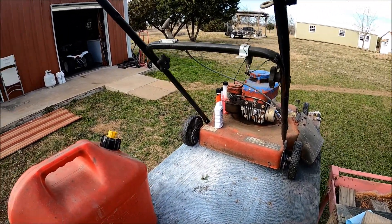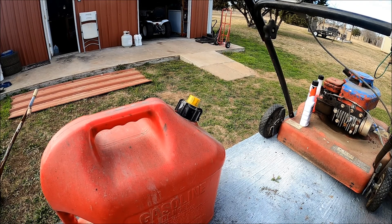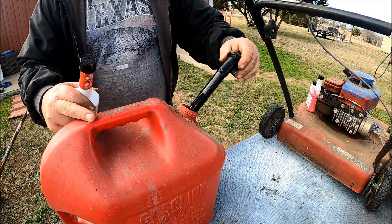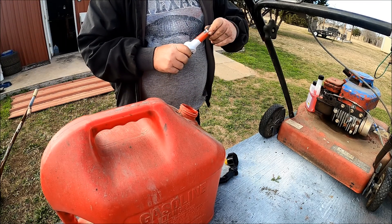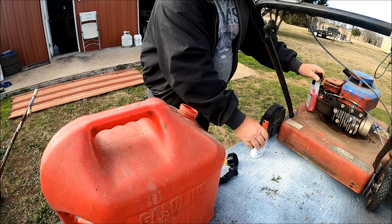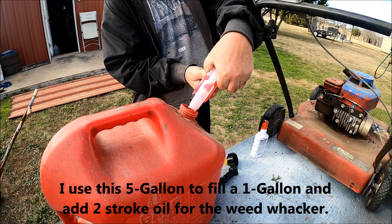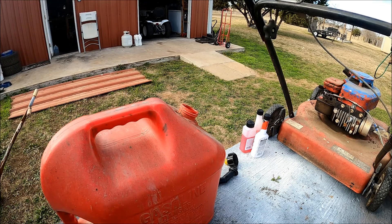Been working on the Heinz 57 — you can hear Fort Hood over there. I don't have any fuel mix, so what I do is this is five gallons exactly as measured at the pump, and we'll put one ounce of STP fuel injector cleaner in it — one ounce — and we also put one ounce of the red Sta-bil in it — one ounce. We'll shake that up a little bit and we'll put it in the mower and do a first crank.